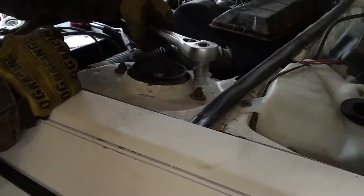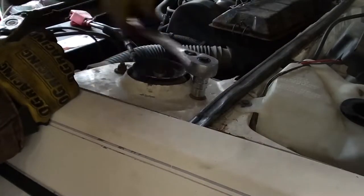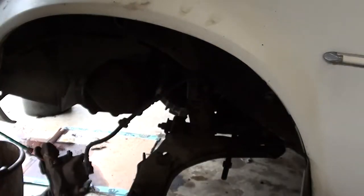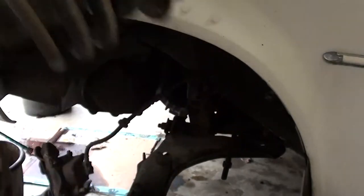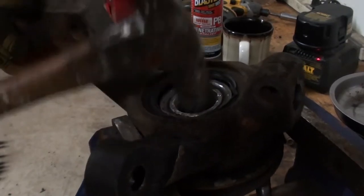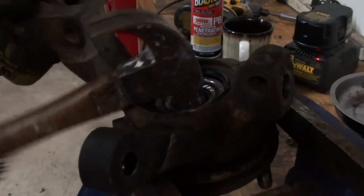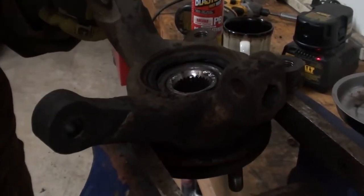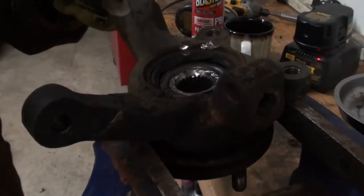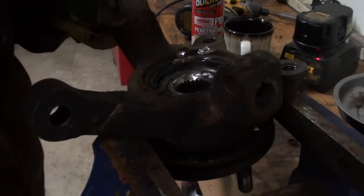On this side, I'm going to demonstrate the proper way to remove the strut tower — by loosening these two 13mm bolts and just dropping the entire assembly out of the vehicle as one piece. That's probably how that was supposed to go. I knew better than to mess with this hub and try to get it out of the knuckle, but I had to give it the old college try by hitting it with a hammer. After just a few minutes of that I quickly realized I was messing up the knuckle itself and that what I really needed was a press.